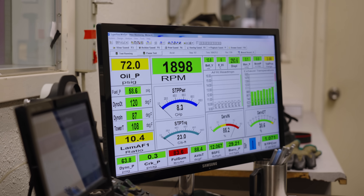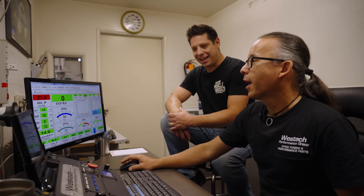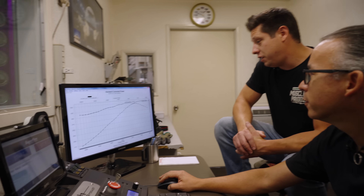We both saw 350s — that's more than I'd expect a factory 4.8 to make. This is at the flywheel, so with optimized headers and cold water we're getting all we can get. This is an engine dyno and not a chassis dyno, so we're going to see numbers a little higher than what you'd get to the tire — no drivetrain losses, cold water, good high-flowing headers. But it's good to get a baseline, and our baseline was 355 horsepower.